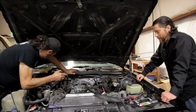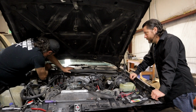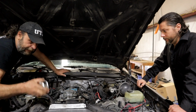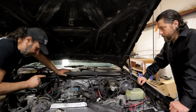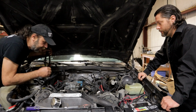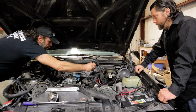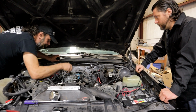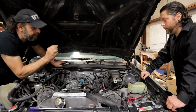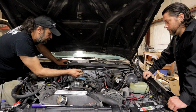So what you're gonna have to do is get yourself one of these PCV breather caps that has a PCV valve built into it. And also you're gonna have to do something with that line, the power brake line. Because the fitting that's in there now, and that trim screw isn't really in there, so there might be a little bit of a vacuum leak from that also. But you're going to have to find the right combination of fittings to work with that.